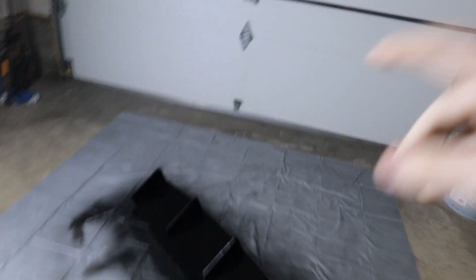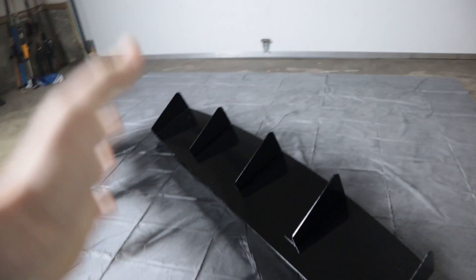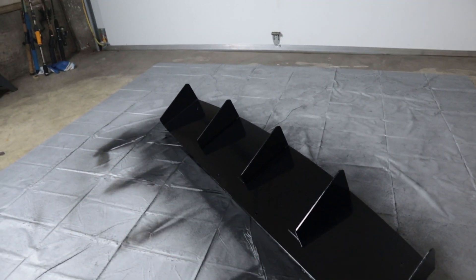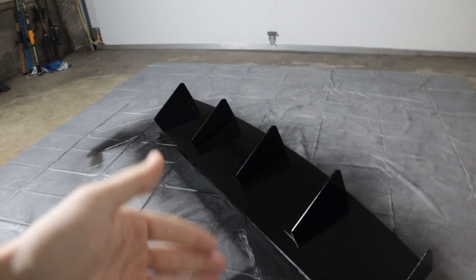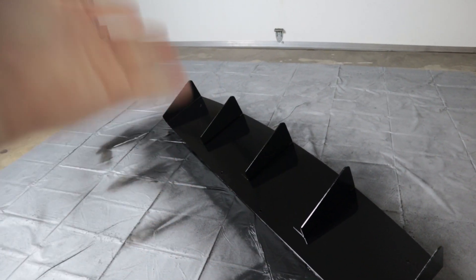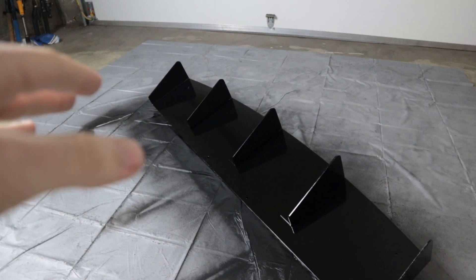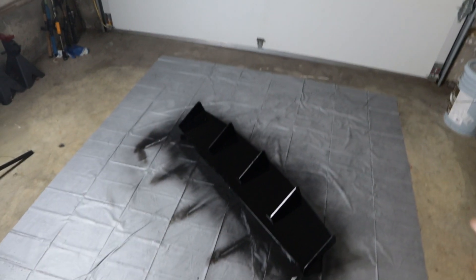The next day. Last night I finished painting up the diffuser — I wasn't going to record every single coat because it's monotonous and boring. The diffuser now has two coats of black and a clear coat over the top. As always, if you're spray painting something, go really slow and lightly coat it on. You don't have to put it on very thick. It's better to do multiple coats than to rush through it and have it drip, because that is just the worst thing that could happen. I'm going to go ahead and pull the Mustang back up and throw this on there because the install is almost done.